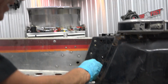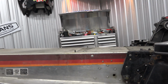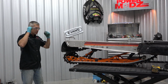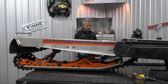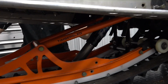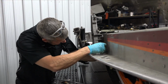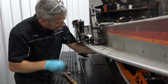Generally speaking, if you can get these first holes into place, or the front arm of your suspension into place, and then mount your back up, the rear idlers, when you take up the slack in there, it's going to pull everything nice and tight and give you enough track tightening ability, if you will. It's going to work out great. Just that way a little. Push it away from you. No, other way. Okay, hold on. Oh yeah, right there.